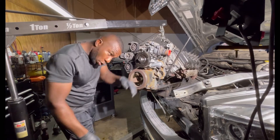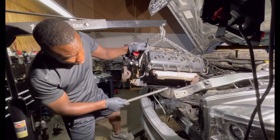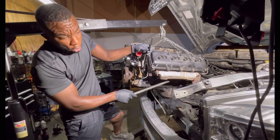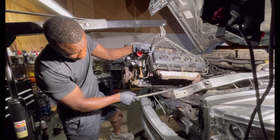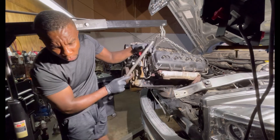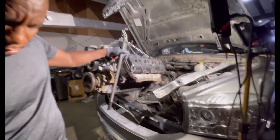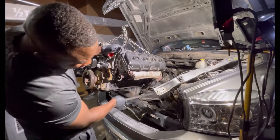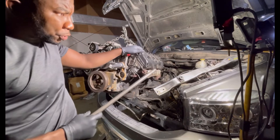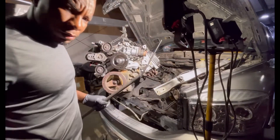Make sure at this point that you got your torque converter in the transmission and you have your flywheel on the engine. You got a washer right there — there's a spacer right there — so you're trying to get in there and line it up real nice.